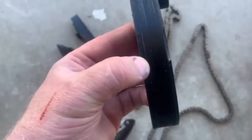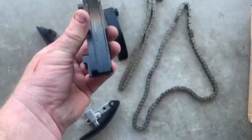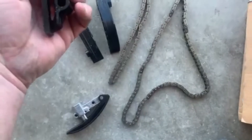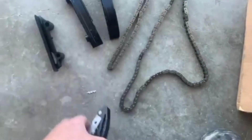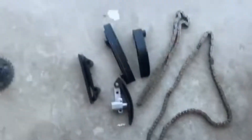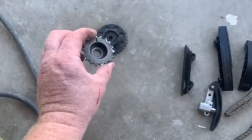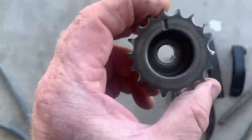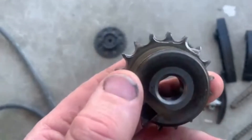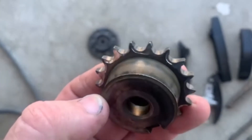See where it's broken right there. This one — no signs of damage. And then this one is one of the guides — that was the one that was broken. This is one of the tensioners. And then this is your oil pump drive gear, and this is the gear that sits on top of it. Initial look it seemed fine, but get a little closer and you can see some wear marks. Flip it over and it's even worse. The chain actually wore a groove down into the sprocket.